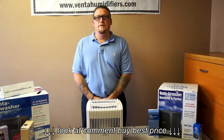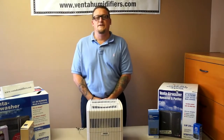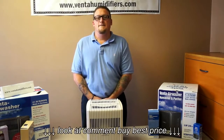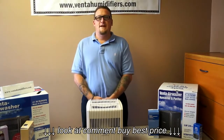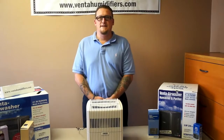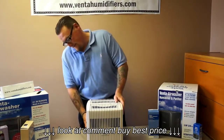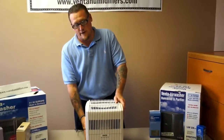This video covers how to replace the motor for your Venta air washer. Some typical symptoms of a bad motor include hearing some sort of constant noise, the unit being hot to the touch, or the fan not spinning. On our Plus units, the LEDs on the top of the motor are both lit up while you have a full lower housing of water.